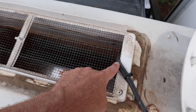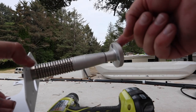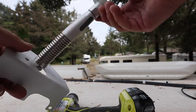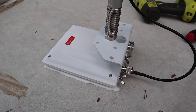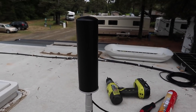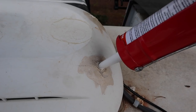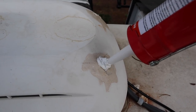We're going to follow the solar line that goes down behind the fridge and tap into that, so I don't have to drill another hole anywhere in the roof. I'm putting together the mounting spot for the antenna and I just noticed this spring mechanism — the whole thing bends, so if you hit something hard it'll be a little forgiving. I got this piece put together and mounted into the back of the amplifier. There it is all wired up — it looks funny but it's going to give me cell service. Now I just need to fill up these holes now that I've got it all screwed back in.